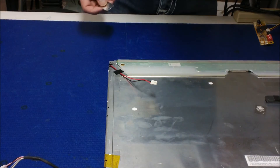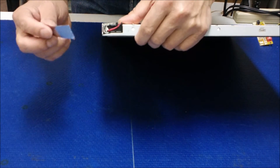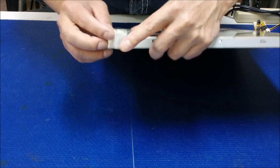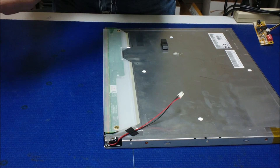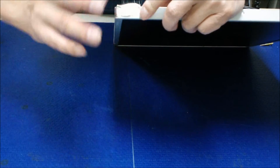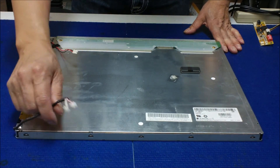All our UB series kits also come with what we call aluminum foil. If you fire up the LED, you might see the light bleeding out because there are no rubber boots on the LED. So you just use this to cover it — like this — to prevent the light from bleeding out. Cover it. That's it. One is done, and then you just repeat the exact same procedure on the bottom one. That will be it. Thanks for watching. Bye.